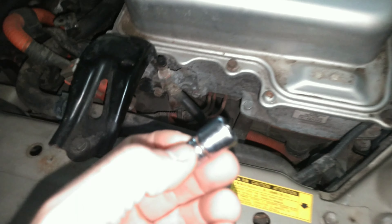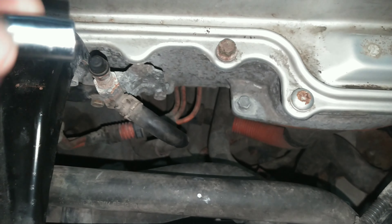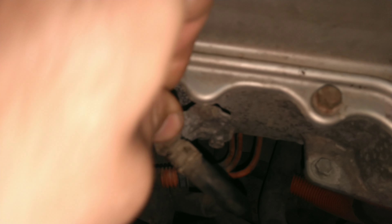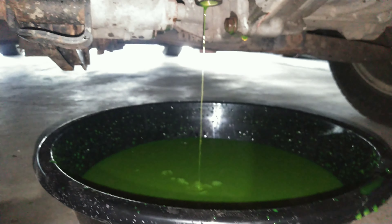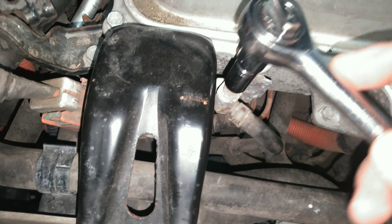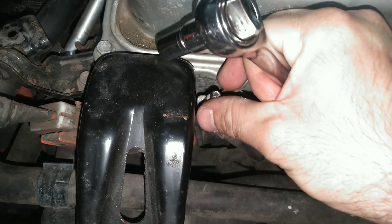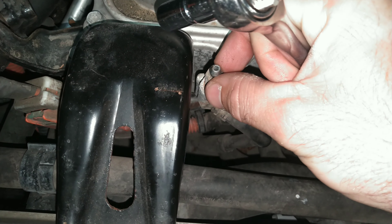One last thing you're also going to need is a 10mm socket, because the 10mm socket goes on this little plug — this is the bleeding valve. You take that little rubber cap off and we're going to use that. Once the coolant is almost finished draining, take the 10mm socket and loosen the bleeding valve just slightly so you can unscrew it by hand. Don't take it all the way off — just two or three or four turns.